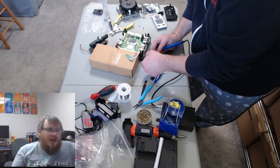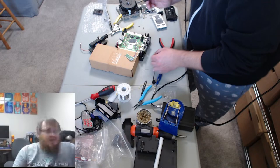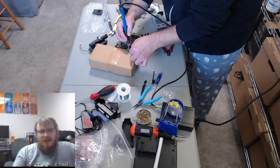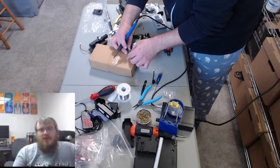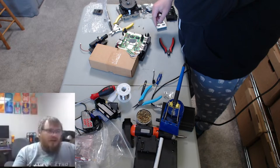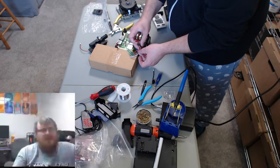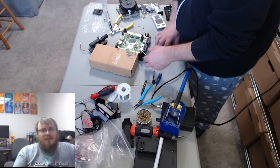I prefer the PlayStation 5 controller. Destiny recently hooked me up with one of those, so I was able to use it for the first time. There is a firmware update that you might need to do to it. The PS5 controllers have the lowest latency, less than 6 milliseconds, like 5.2 or something, to the Blue Retro board. And then the Blue Retro board's latency to the console is nearly zero, because it's directly connected and it just translates the Bluetooth commands to GameCube commands.